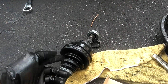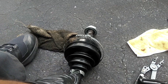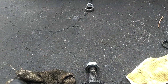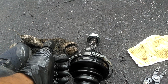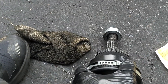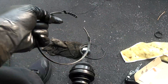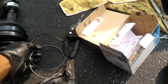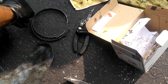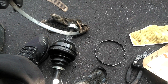There's a little bit of a pain getting the boot to pop up on the end, but we got it going. This inner clamp is fine — I was able to adjust it. But this outer clamp is not even close. Either I got to find a big zip tie or use the old clamp that I pulled off of this boot, because this clamp is no way going to snap on there. Could not find my giant zip tie, and this clip is smaller than the clip that came off — it won't fit. So I opened up the old one a little bit, and I'm going to clip that on there and secure it.